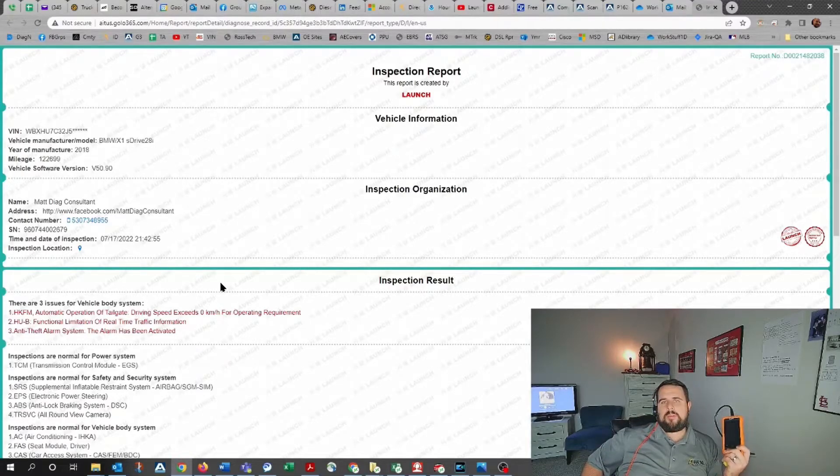One tool I have — I didn't want to spend $1,200 on an update simply because it's getting older and I think that's ridiculous. So this is $200, and it says it does Valvetronic relearn. I have not gone down that road with it, but it says it's there. Everything I've done as far as on the tool is there — bi-directional controls, I registered the battery, reset throttle adaptives — everything has worked.